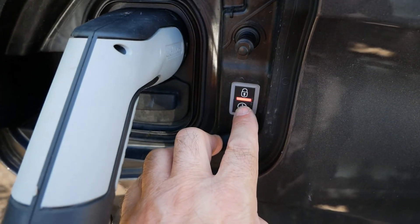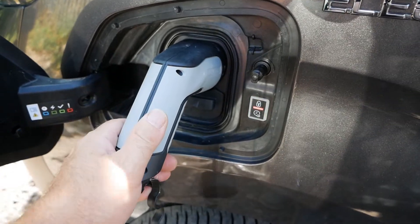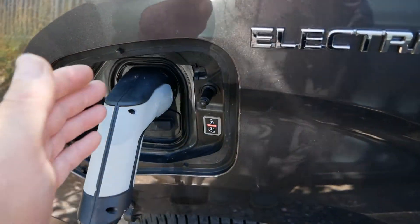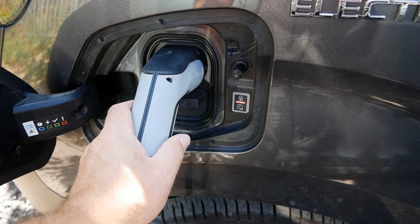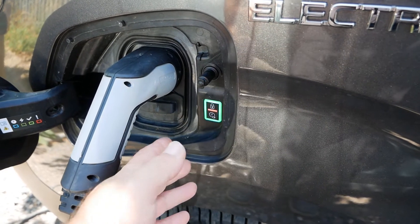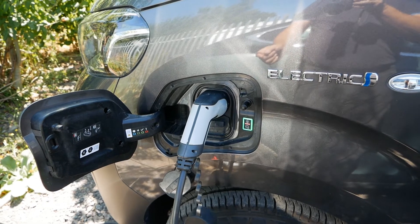I hope that helps and explains what that lower button is for on these vans. For most people it doesn't matter that these vans don't have the scheduled charging functionality, because we've all got smart chargers now. If you've got a more modern wall charger — in this case a Wallbox — these all have scheduled charging built in which you can control via the app. It's generally better to do the scheduling via your charger rather than in the car, because it's tied to your premises and you don't have the issue of turning off your scheduled charge when you want to charge on AC throughout the day on public chargers. As always, hit the thumbs up on YouTube if you found this useful, do subscribe, and I'll see you on the next video.